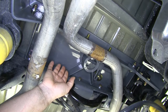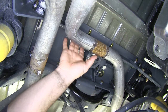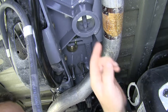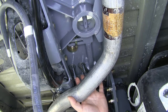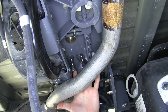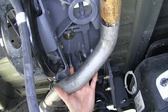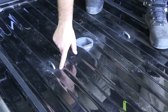This hitch is not going to require any welding or drilling. It's going to come with all the necessary hardware and it's going to have a nice gray powder coat finish to resist any rust or corrosion. You're going to have a single spring-loaded safety pin. Your U-bolts for your safety chain hookups in the bed of your truck are also going to be spring-loaded. That's going to help when not in use to keep them nice and close down inside the corrugation.